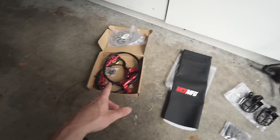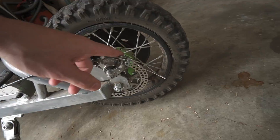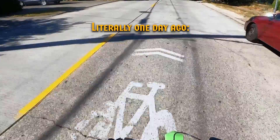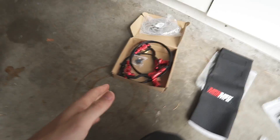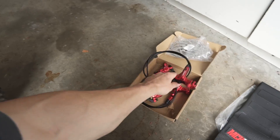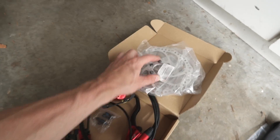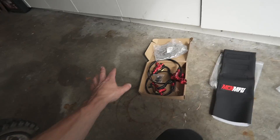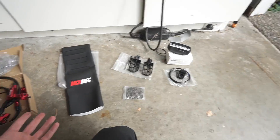Because this thing is so insanely dangerous, there are some very important upgrades we need to do, and that's what today is all about — taking this from a semi-finished rideable version to a more advanced, safer, more fun version. First things first: hydraulic disc brakes. These mechanical ones do technically stop the bike, but they're a little sketchy. They squeak a ton, don't provide much stopping power, and don't give a whole lot of modulation. These are the exact same ones Electro and Co uses in their kit, with the 48 millimeter bolt pattern rather than the standard 44. All this stuff is available on Amazon — links down below.